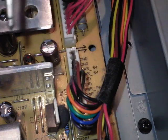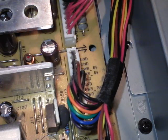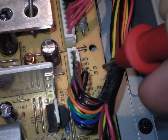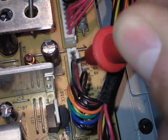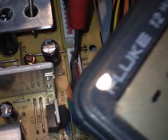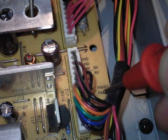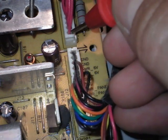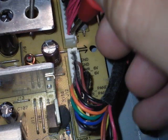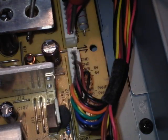You want to take your black lead and touch the frame — the chassis of the TV is the ground, by the way. Right here it'll tell you the voltage. It says 6 volt, so if you touch it right there, it'll say 6 volt. There's your 6 volt. Next you want to check the other one — this one right here actually says on the board it says 24 volt. So let's go ahead and check that right there — and boom, 24 volt. So it looks like the power supply is so far good.